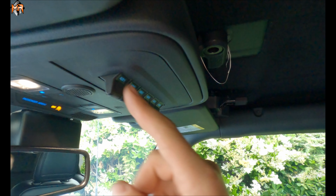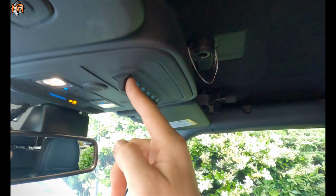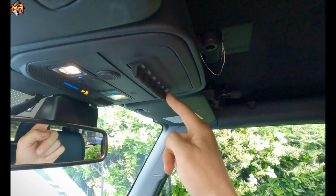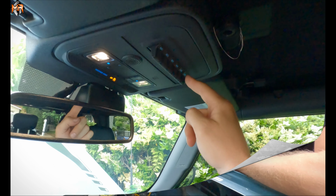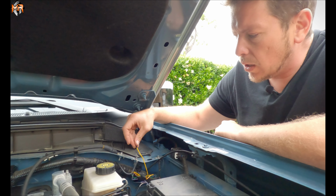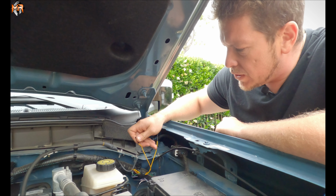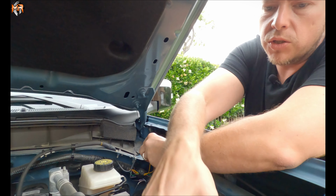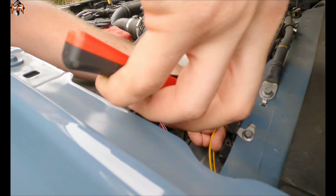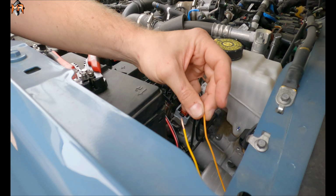And here are the switches, 1 through 6. So we're going to use switch number 1 for the white function of the lights, and switch number 6 as the DRL. If you see from the bundle of aux switches, we've located the solid yellow as well as the yellow with the orange tracer. I'm going to go ahead and strip them. So here I've taken out the 2 wires.